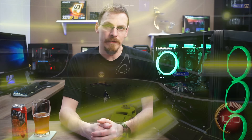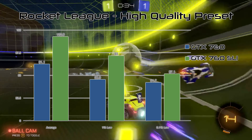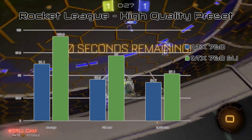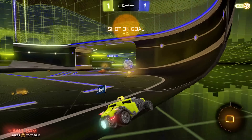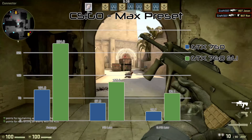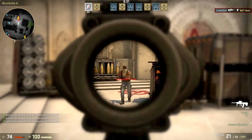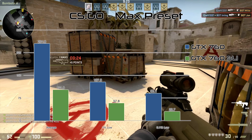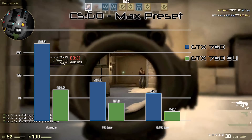Rocket League shows numbers very similar to GTA V, with good scaling — the average FPS at 81 improved 49% to 121, and lows bumped from 55 to 67 FPS. Rounding us out is CSGO, where a single GTX 760 managed 255 FPS on average with a 0.1% low of just 90. Moving over to SLI, we actually saw a 60% drop in frame rates — the average fell all the way down to 102 FPS, with 0.1% lows dropping into the high 20s. Not a good look.